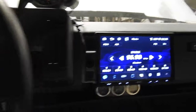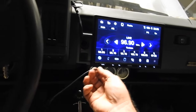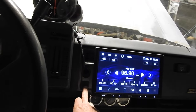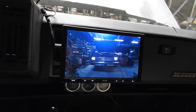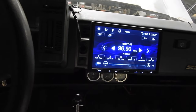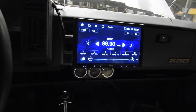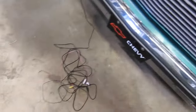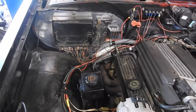There's the mute button. More good news: while I was wiring all this up, I hooked up the light for the tag. If we turn on the parking lights, the tag lights up; turn on the headlights, the tag lights up. More good news: if we flip this switch, the backup camera comes on. I ran the cord around to the front of the truck so it shines back out. To prove it's really us, if we turn on the headlights, you can see them come on — headlights go off. That's really cool. We don't have to put it in reverse; we can use the backup camera at any time. Here's the wire for the backup camera — I just drilled another hole in the firewall. There are a total of three holes: one has all the important wires, one has the antenna wire, and one has the backup camera wire. I'm going to buy some silicone to fill all those holes — keeps the water out, keeps the wires from rubbing on the metal.